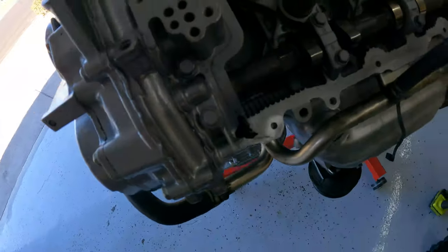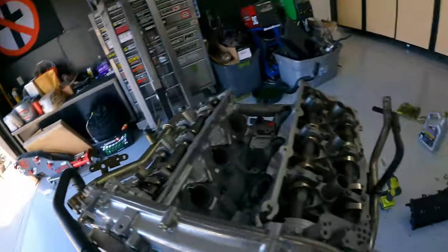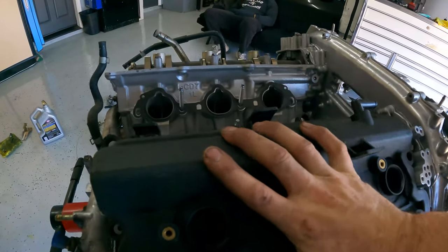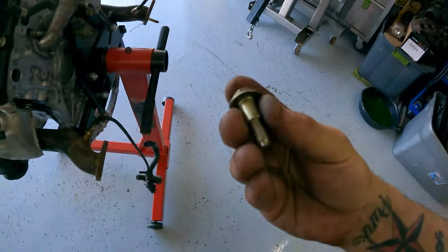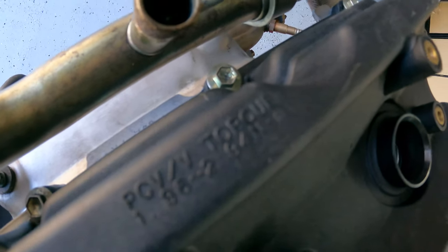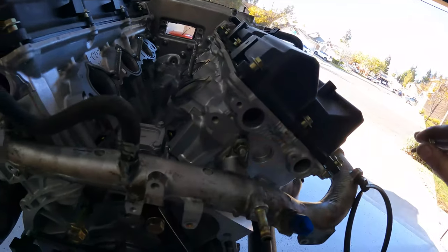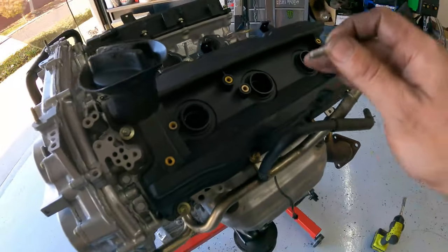The RTV — FIPG — looks like that. Now we can put the valve covers on. This one doesn't have the oil hole so it'll go on this side. Since those are all oiled up, push down with even force and it kind of seats. Now putting all the hardware in — you can see what the bolts look like for the valve covers, they've got this step on them. There is actually a torque spec for it, and it's right there in newton meters. Honestly I don't use a torque spec on these — because of this collar and it only has so much thread, it will bottom out. When it bottoms out, I'm done. I've tried doing it with the torque and actually broken them off, so I run it down until it hits the collar and that's it.